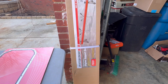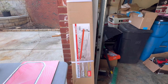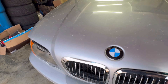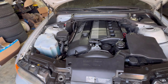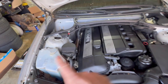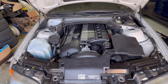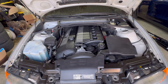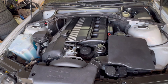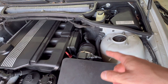You can pick this up at Harbor Freight - there's the part number, I'll put that in the description. They're about 80 bucks, they come on sale all the time. Basically you need to support the engine using this lift hook point right here. It straddles the strut towers and supports the engine because we actually have to drop the subframe in order to get this oil pan off. So a couple things we'll need to get out of the way up top is get this air intake system out and the upper intake boot.